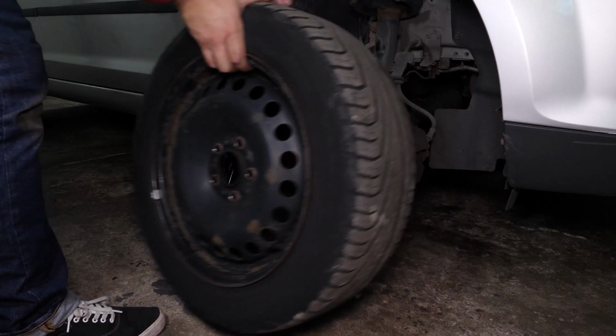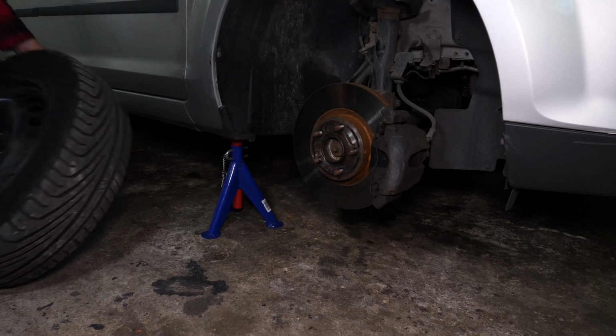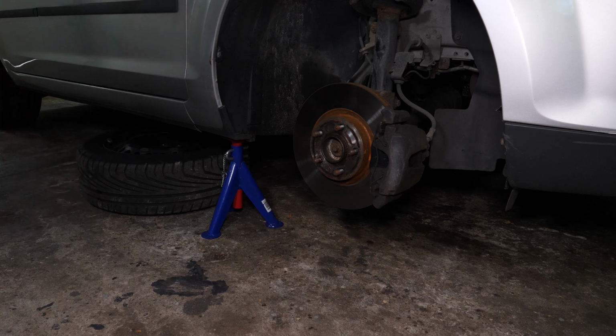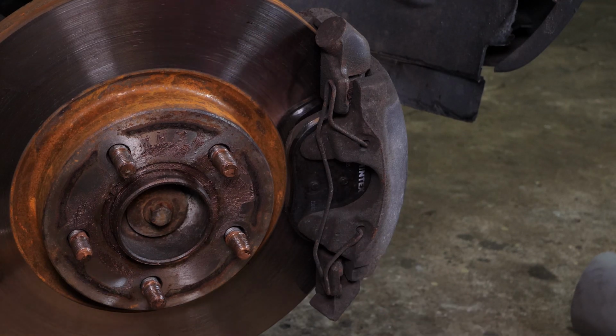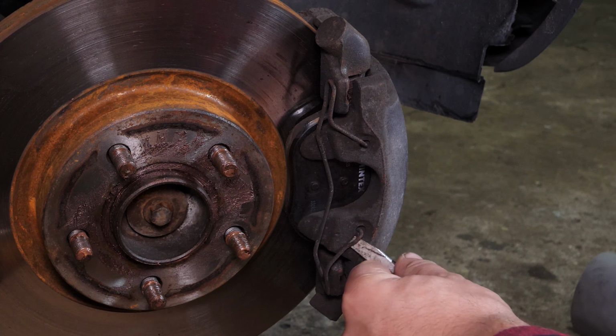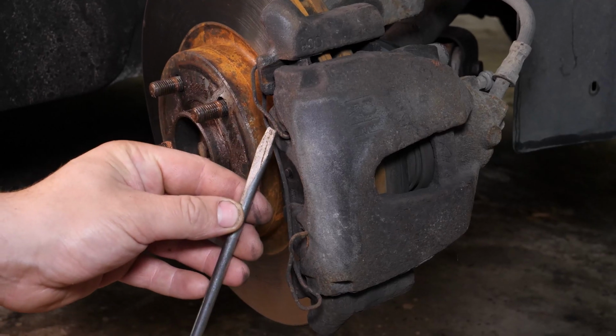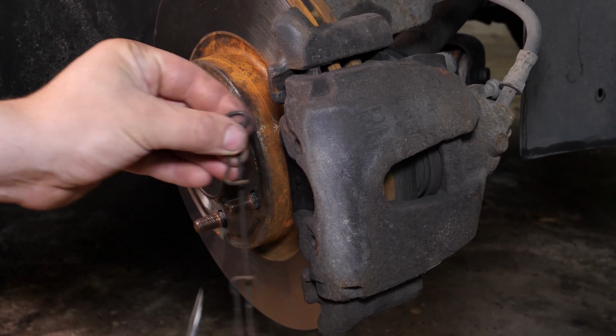You will then be able to take off the wheels. Don't forget to slide them under the vehicle. Turn the disc outwards. This will facilitate the process. Using a flathead screwdriver, lift the holding springs on the pads, then take it out. Make sure you keep a finger on the spring during the operation to avoid it jumping out.